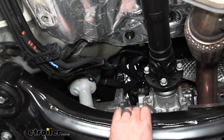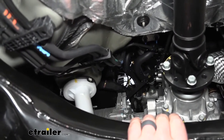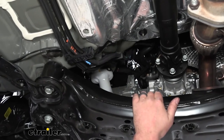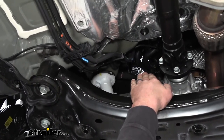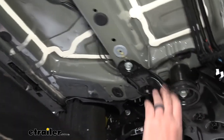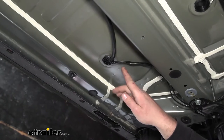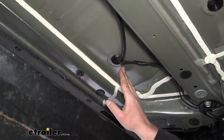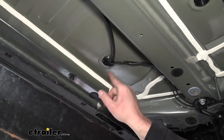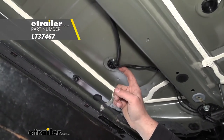I separated the wires from the black sheathing material and pushed only the blue wire and the thin red wire up inside through the grommet. The black wire I routed up into the engine compartment toward the battery — it comes up right through there to where the battery is. When I pulled it tight and got close to the positive battery terminal, I had about five or six feet of extra wire remaining that I didn't need, so I cut it. I dropped that cut piece back down inside following the same path, since we'll need to hook it up inside. Once done pushing everything through the grommet, seal it up with silicone, which you can pick up at E-Trailer.